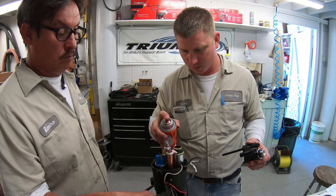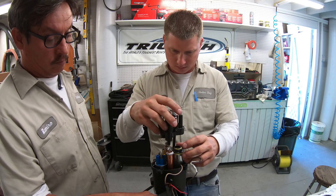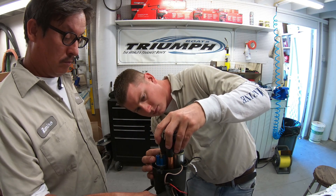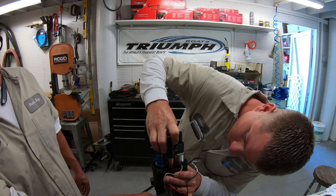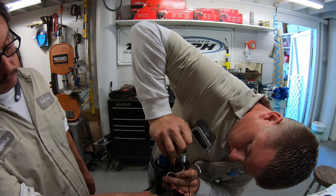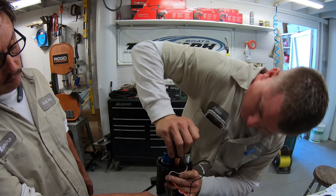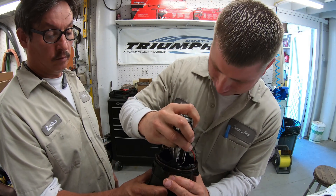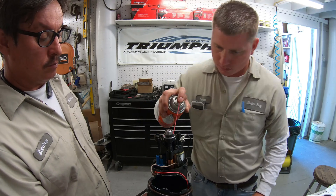Install a plastic spacer with the o-ring on top of it and get all of the fuel pumps and tubes lined up with oil on the gaskets. With everything lined up, just wiggle the piece and firmly push down until you get everything to slide into place. This gets us about halfway there. Now we can install the rest of the rubber grommets halfway in place like we did with the fuel pumps, and don't forget the ring and gaskets on the pressure regulator.